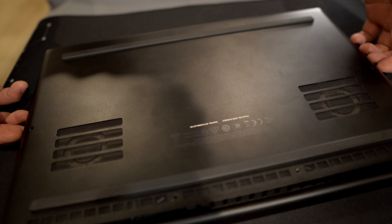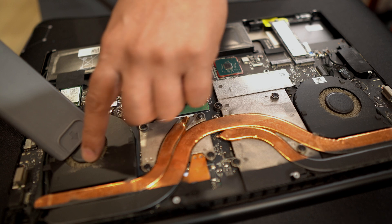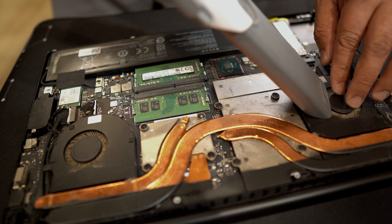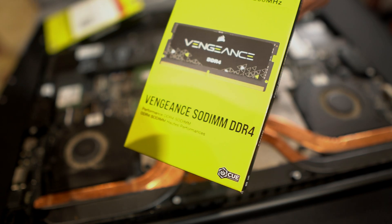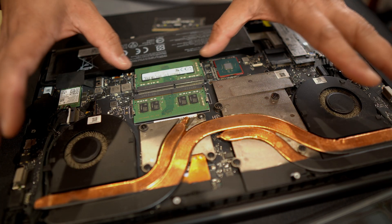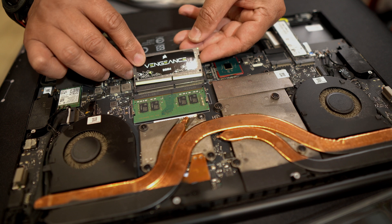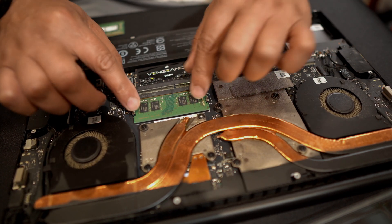While you're ready to remove the laptop cover on the back, you might as well do a little cleanup. We're going to vacuum the CPU and GPU fan, taking out a little dust here and there — it helps out in general. Then we prepare our new RAM. All you've got to do is unclip both sides of the slot and slide it out. Installing it is the same: insert it at a slight slant, then push it inward. You will hear a clip, and that's it.